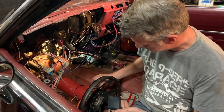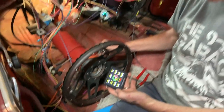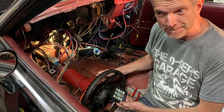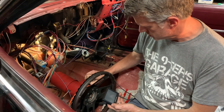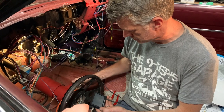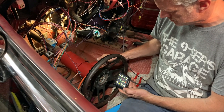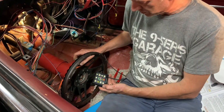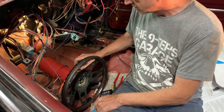All right, ECU. How cool that is. That never gets old. Hey, we're at 14.3 now. Let's look at the cranking amps now, too. You ready? Here we go. Oh, that's shutting off still. It's still on, it just doesn't have the amperage. Battery's crap. But we got switched cranking power, we know that for now. Well, that's frustrating. After all this, a stinking battery is going to kill us?